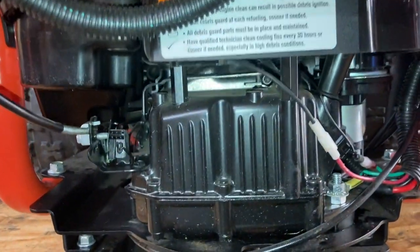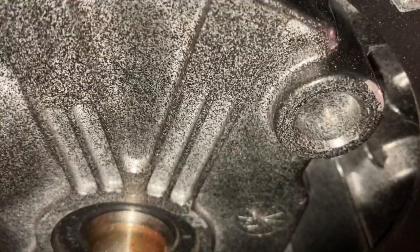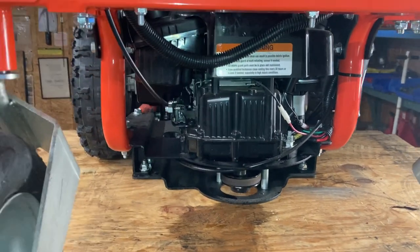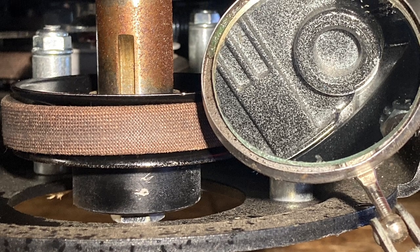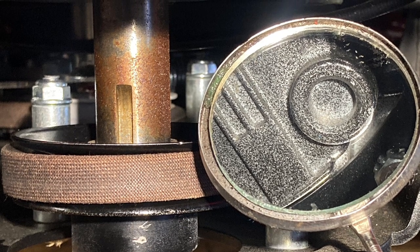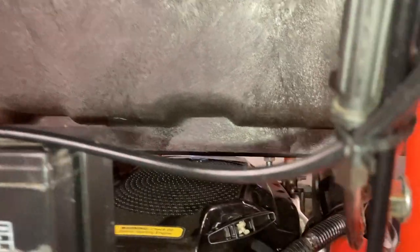When I want to change my oil, I'm looking down on the sump of the motor where it's mounted to this frame. Ironically, the manual prefaces that there's a 3/8 socket plug underneath in that very sump, but it's not there. There's nothing there — you have to suction it out the fill tube. I mean, even that's doable, stop the drama, it's not going to change the game. But there's my mirror pointing in the direction they say the plug is located — and it's not there. A little bit inconvenient, and I can't see why. The motor likely fits a myriad of different applications, so they probably just order them by the hundred thousand.